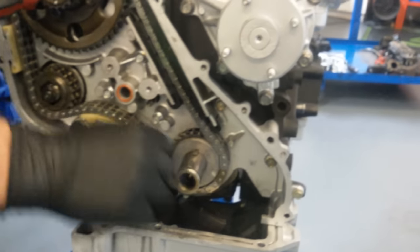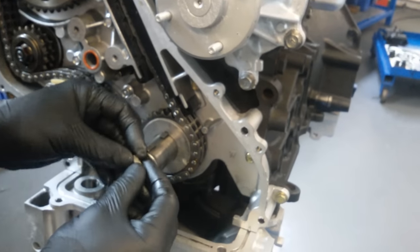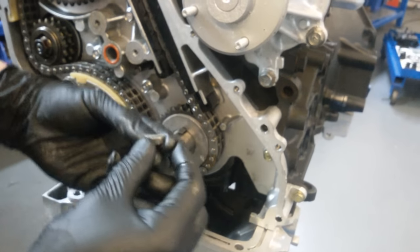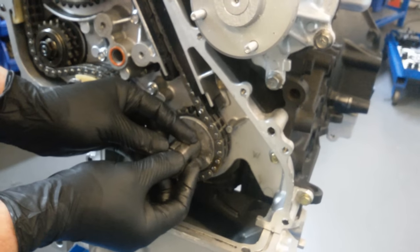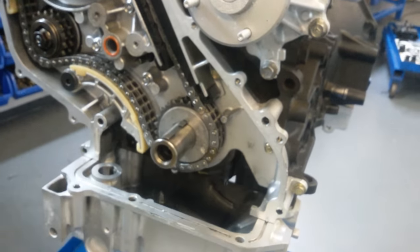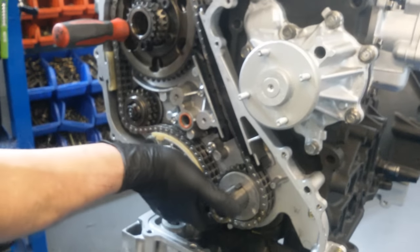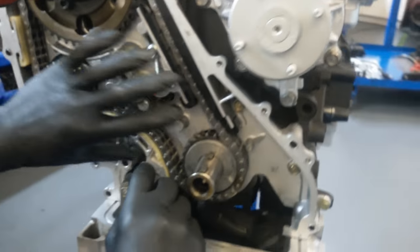There's three gears that sit on that crankshaft in all together, and one of the things that you've got to watch out for as you're fitting each one of the gears is that woodruff key there, which sits there, is half moon shaped, and it can be very easily knocked out, and there you go, it disappears into your sump pan. And normally there's a balance shaft inside there, so that can cause severe damage, and that means you have to remove the engine to get that woodruff key out, because you certainly don't want it flying around in your engine. Bottom chain tensioner.